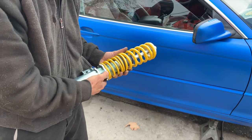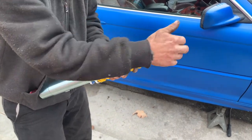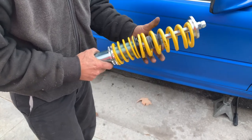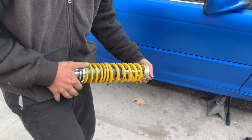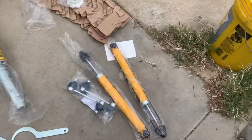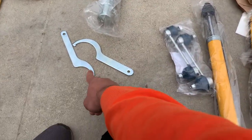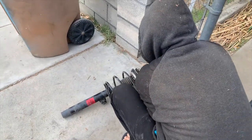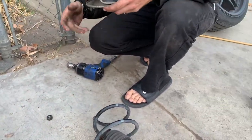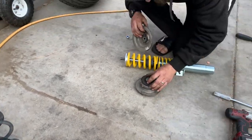There goes my suspension and Mike's trying to fit it up. You just gotta figure out which one is right and which one is left. I'm just setting the nut on top because it's not threaded all the way in — just to keep everything settled nice and even the way it should be sitting. Once everything's set I'll go ahead and install it, and once we've got all of them installed I'll set ride height from there. These are my rear springs, and these are my sway bar links.